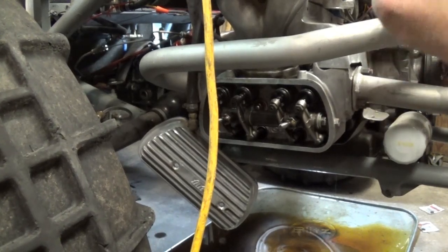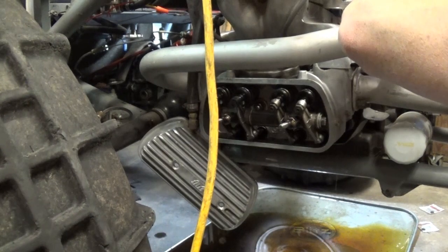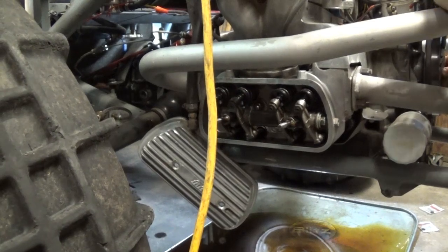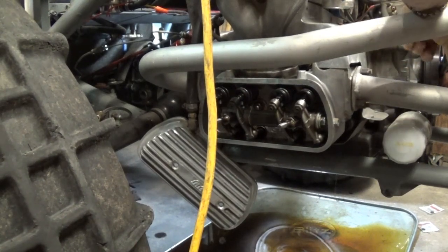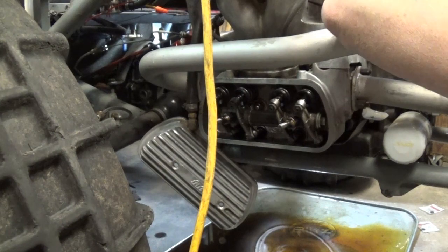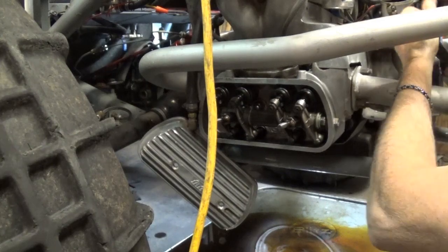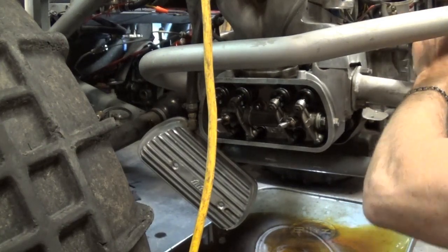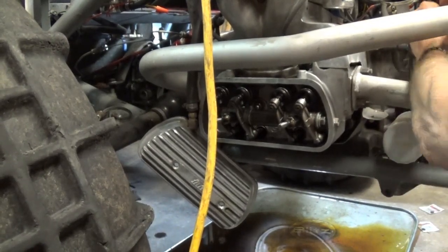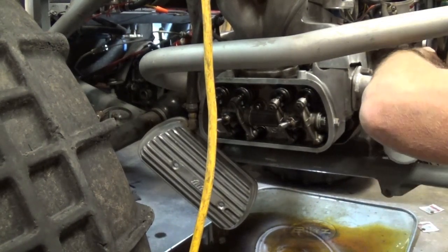We're going to go 180 degrees on the crankshaft. This baby's hard to turn — it's got 9-to-1 compression, but I live at high altitude and I am worried about how this is going to be at sea level. The guy I bought the buggy from lived in California — that's where this car came from. He said he lowered the compression because it was even higher — had 11-to-1 — and it only has 49cc heads, so I can see where that's possible.